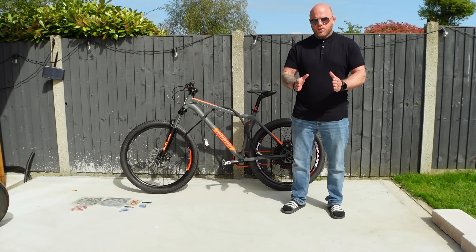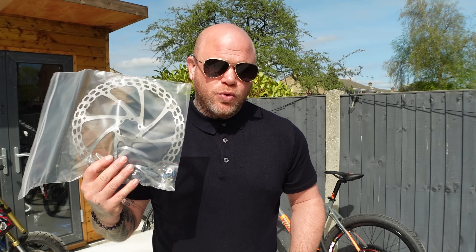First off, a 220mm front brake rotor. The standard brakes on this are 180mm up front and 160mm on the back, which is quite common on most entry level bikes. 220mm is going to give us a lot better stopping power and overall efficiency without costing the bank. Check the Uber Bike website - I'll put the link in the description. They're really reasonable and I'm pretty certain they do discs up to about 240mm, also in 2mm thickness. Thicker discs are less prone to bending and more efficient at dealing with heat.